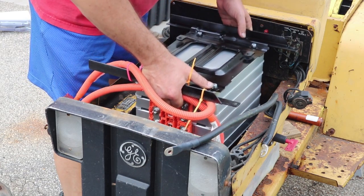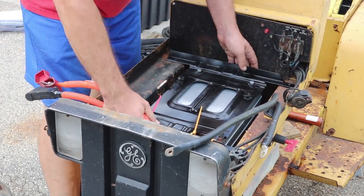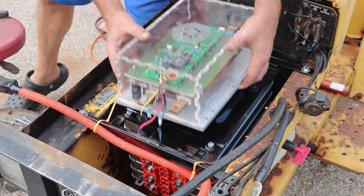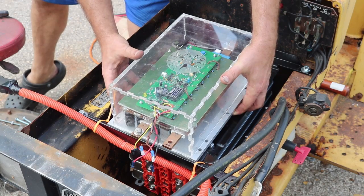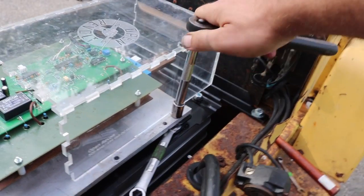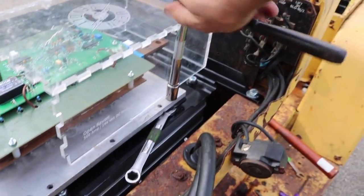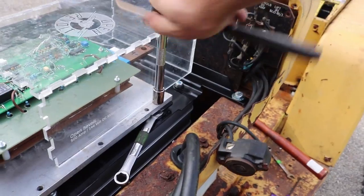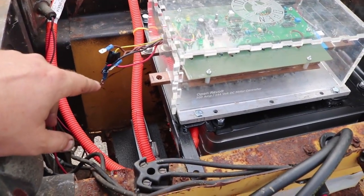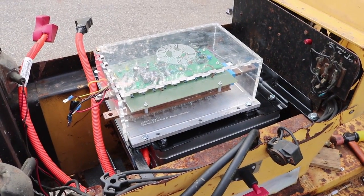Big moment — putting the battery pack in! These nuts for holding the controller down are very close; there wasn't much of the heatsink sticking out outside the case, so it's just a little snug. Takes a few minutes but it is getting there. Still left room over here for the main contactor, fuse, and battery disconnect. Looks like I'm starting to get ready to do actual wiring.